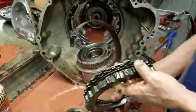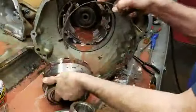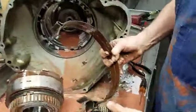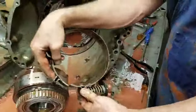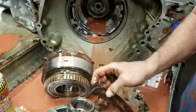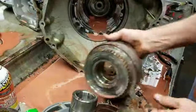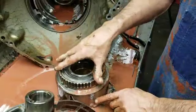If it's a diesel you want to play with, you can, but I'd recommend just putting the four clutch back in. Now here's your engine brake band that goes on this piston like this — it anchors in the case and pushes around that drum. You pull it down from third to second and this band will physically come on. Now here's your intermediate sprag for second gear.